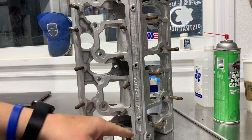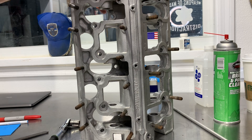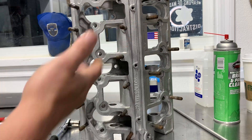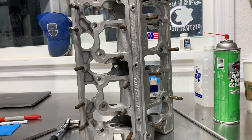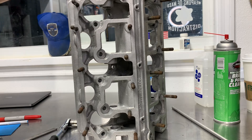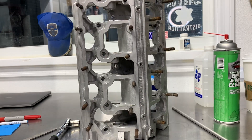When you know you don't have any stripped threads, take it slow and easy. We're not trying to take off any metal — we're just trying to see or feel any high spots. If we do, pull the studs out and flat the whole surface. This one looks pretty good, so we're not too worried. Then we will ultrasonic clean it one last time and put it together. If it seems worthwhile, I'll try to take a video of the assembly too.